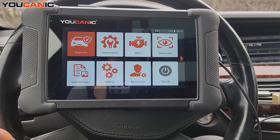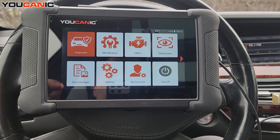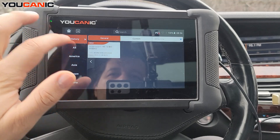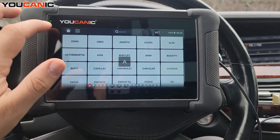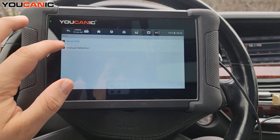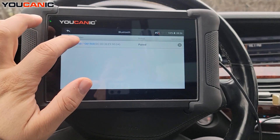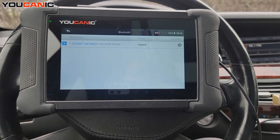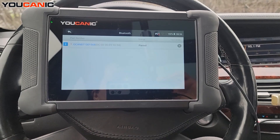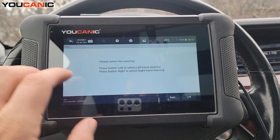What we're going to do is look at the actual voltage readings of the upstream and downstream oxygen sensors and compare them. This is going to work the same for all makes and models, so it doesn't really matter what vehicle you're working on. I'm going to take the Bluetooth OBD adapter and plug it into the OBD2 port underneath the dashboard.